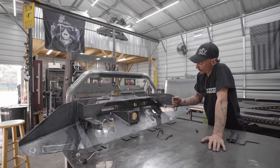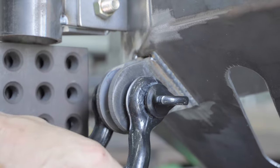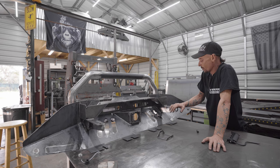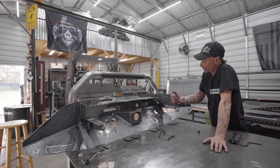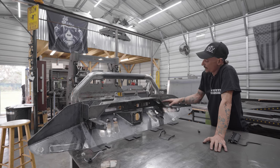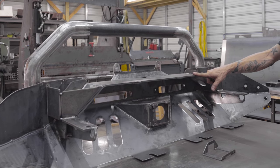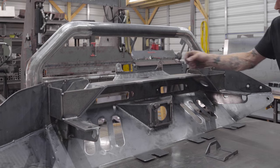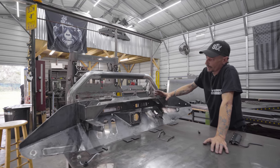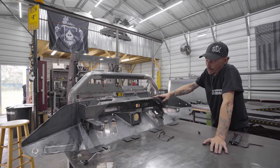You'll also notice that where these mount up, you have a gusset. This gusset runs all the way to your recovery point, goes through the body, making it a really strong recovery point location. This plate is actually formed — you can see here where it's formed and bent. This plate is also tied directly into your winch, making it really, really strong. We thread these holes for your fairlead, so you don't have to reach back in there to get your fairlead on — it's one of the last things you do. It's just a solid piece on the inside.